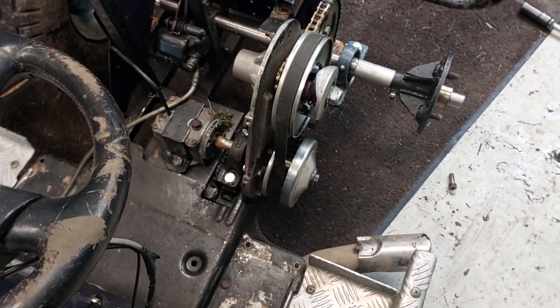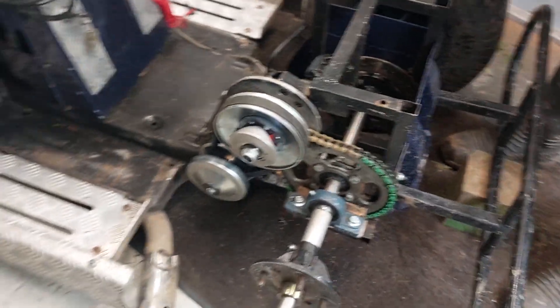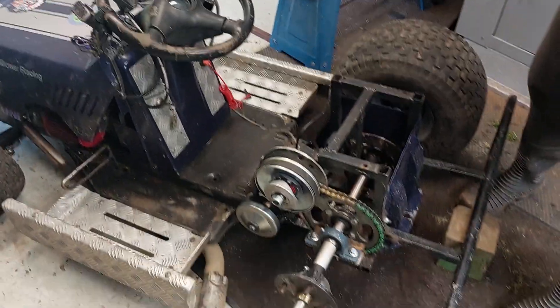Hopefully you can see that working — it seems quite interesting, so we'll give it a bit of a try. It's in the early days of playing with it. I've just added it on to the original mower, and once we play around with the gearing a little bit — I've changed the pulleys underneath to try and get the input speed a bit higher so that it engages earlier. You can also play with the springs on the actual CVT themselves to make it engage quicker or later, and change how quickly it changes its gears. So there's a whole lot of learning to be done, but the basic concept is in there and I'll keep you updated once I've done a bit more playing around with it.